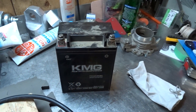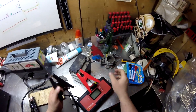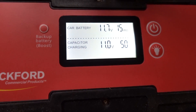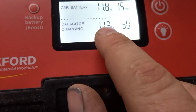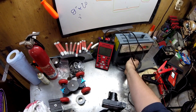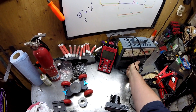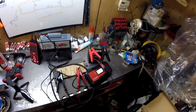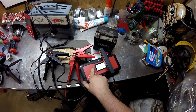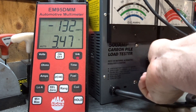First off, let's see if we can charge it with the ATV battery. You can see right there it shows the internal resistance and it's charging up, telling me the jump starter is ready. Crank this thing up — oh, this thing's actually pretty weak, we can't even hit 200 amps off this thing. There we go, 250 amps — but the voltage drop is huge.